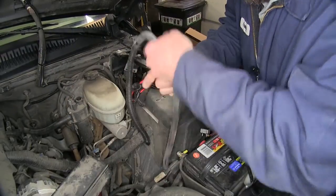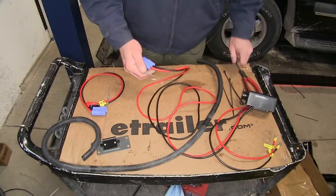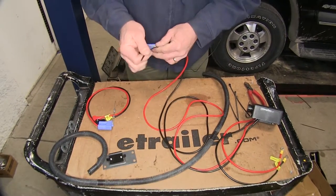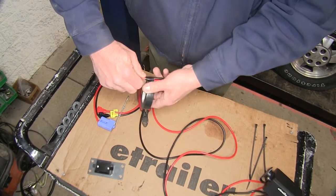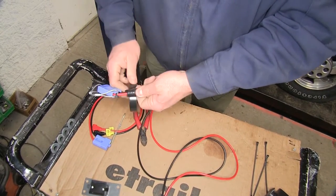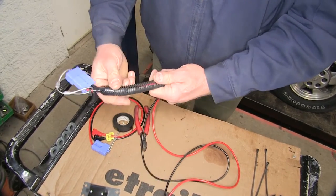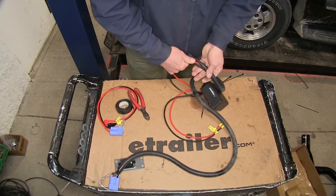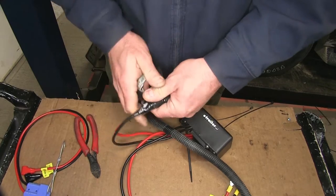Just pull it up out. Begin by installing the tether on the cap, on the cover for the end of your cable. That's the excess. We'll go ahead and put some tape on it and slide our loom up over it. That will keep your loom from sliding up and down on your wiring. Once you figure out where the end is going to be, we'll do the same thing. That will keep your loom intact.